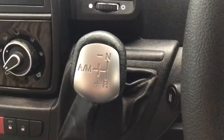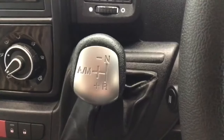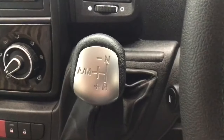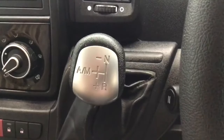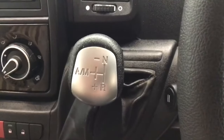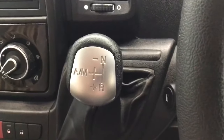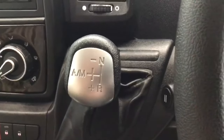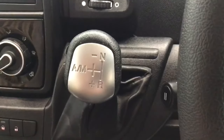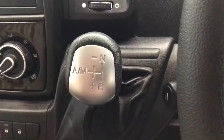The first thing I'd like to do is explain what the Fiat Comfortmatic gearbox is, in very simple terms. The best way to imagine how this gearbox functions is to think of a manual engine, clutch and gearbox vehicle that has a computer controlling everything to do with changing gears. Compared to a normal automatic gearbox, which is a very different hardware setup, this is more akin to a manual gearbox vehicle.